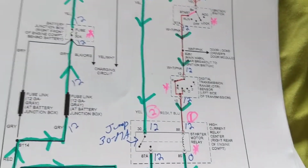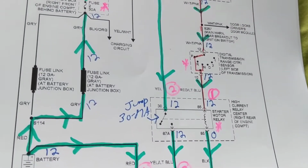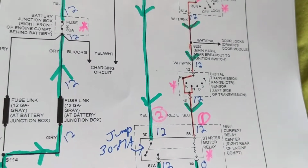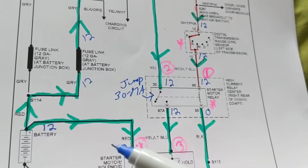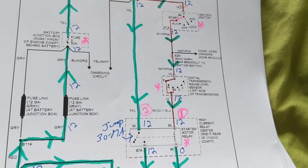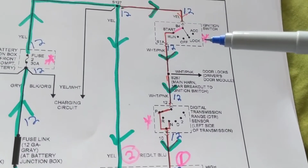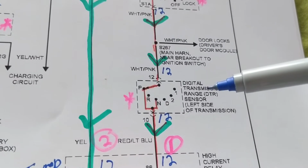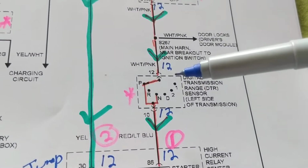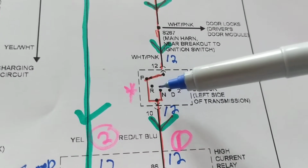Let's start first analyzing the situation, how it works. Again, this is for any Ford. We had this in Toyotas and in Chevys. The principle is the same. Since we're analyzing, there are two ingredients you always need. You always need, like we just discussed, a transmission range sensor. We always have to be in park or neutral. We cannot be in reverse.